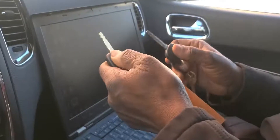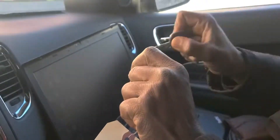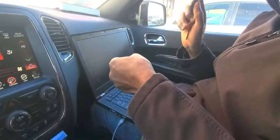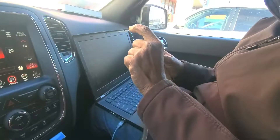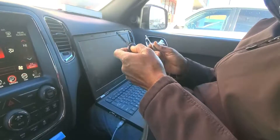The difference between a valet chip and a master chip is this: when you put the key in the ignition, there is a security light. If the security light goes off right away, that means it's a master chip. If it is a valet chip, the light stays on for about three seconds and then goes off.